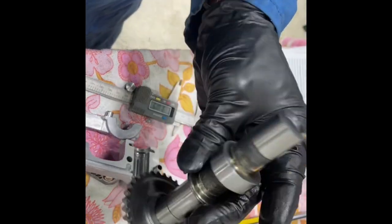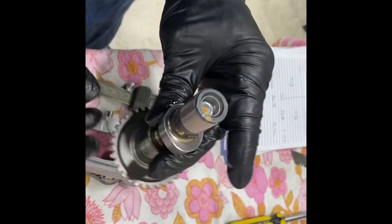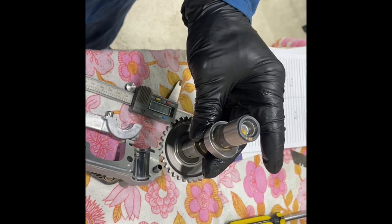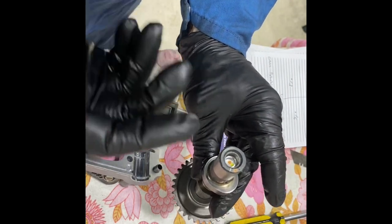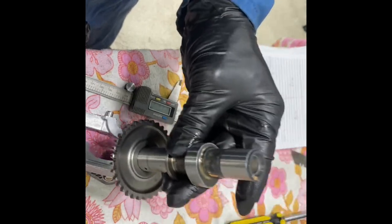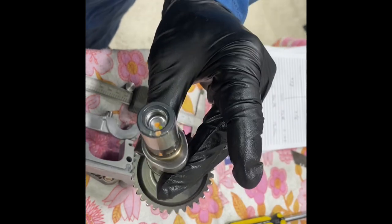And I think this cost me like $33. Guys, this is so cheap. The duration's bigger, everything's bigger. So with the intake mod we've done and all the tuning we're going to do, this is where we get our power from. You don't need to buy both camshafts — just the one intake camshaft and you're good to go.